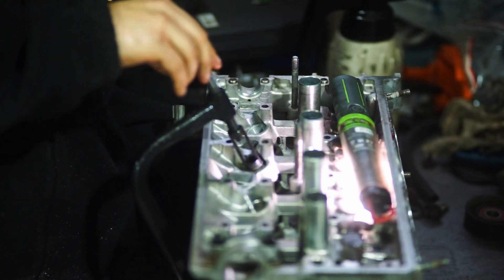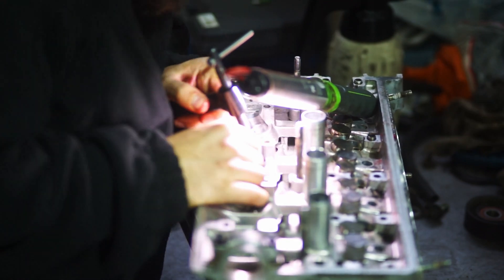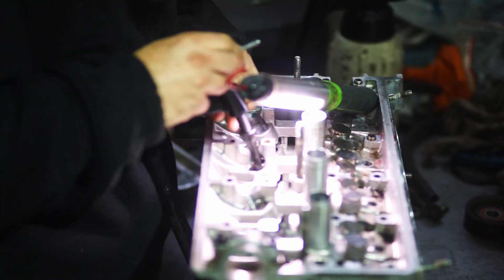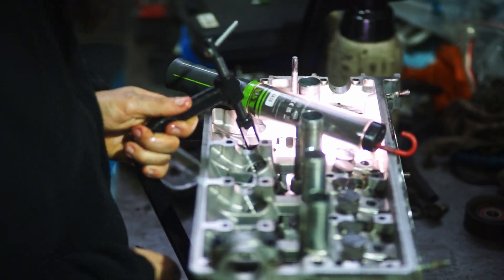Most of the time you can switch around a few shims, and if parts are discontinued — for example the 4AGE — shims are often still available at dealers, in the aftermarket, or can be reproduced. You must make sure valve lash is within spec: if too loose you'll get a ticking sound; if too tight, as the valves expand when hot, lash can go to zero and the valve won't close fully, potentially causing the engine to run on three cylinders when cold or hot.